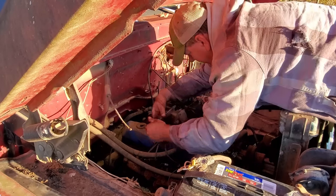That's carburetor. I fixed to take some carb cleaner, spray all around it, see if I can find a vacuum leak somewhere. Well, I sprayed a whole can of carb cleaner around that carburetor. It never once wanted to idle up. So I took it off, and I'm going through it.